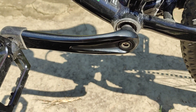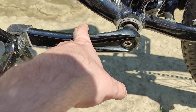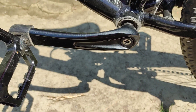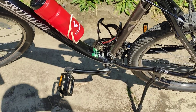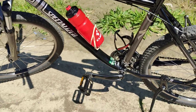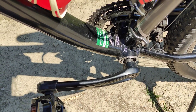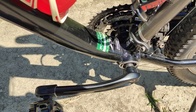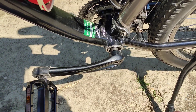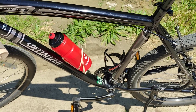Once you've got that figured out, the next thing to do is to tighten the bolts a lot — and when I say a lot, I mean really, really hard. The spindles from the bottom bracket are made from very solid steel, and most likely they will not get damaged if you over-tighten the bolts. That's exactly the idea — that's what you need to do.